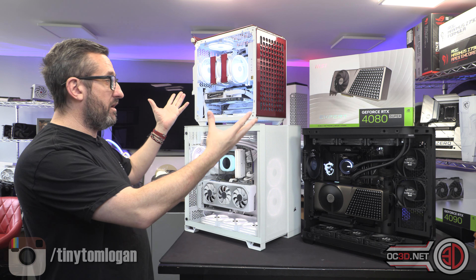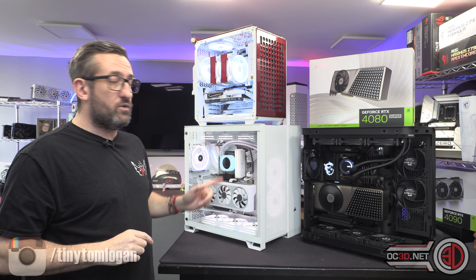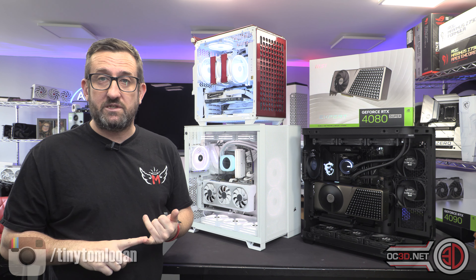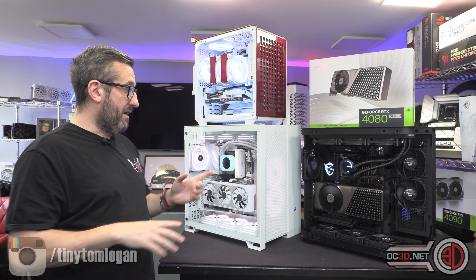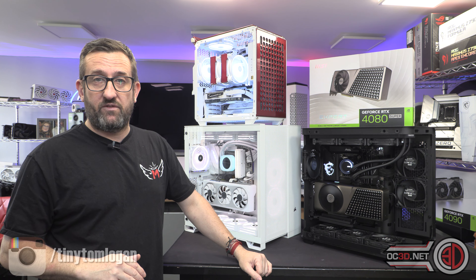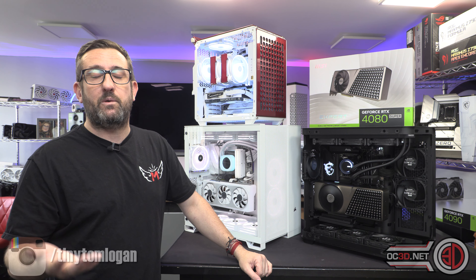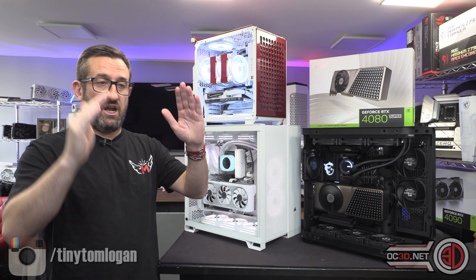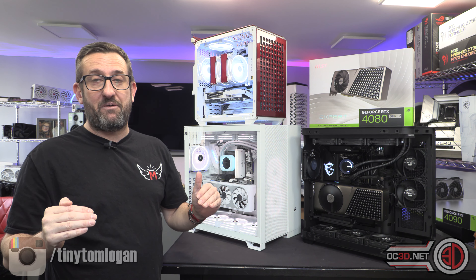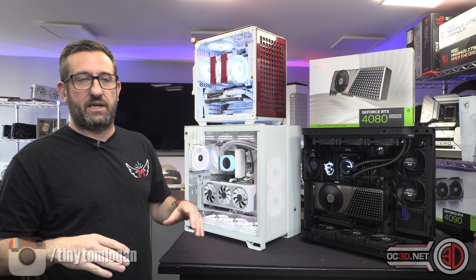With my way of showing you this, you are going to get on the 14900Ks 5.7 all-core at lower temps than you would have at stock. All of these were meant to be 5.7 all-core, but we had some going down to 5.4 and even 5.2 at times with 100 degrees, and the only time temperatures really came below 100 degrees was when they were basically down-clocking themselves.